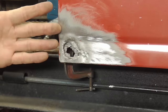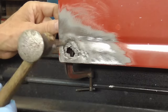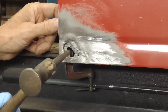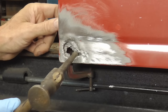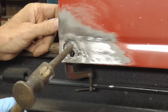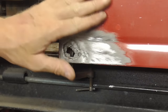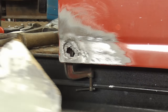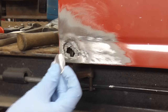The first step in using JB Weld as a solution to fixing a rust hole is to knock out all the old rust. Once you've knocked out the rust, you can grind this area clean and wire wheel it, or sand blast it — whatever you can do to get it cleaned up in there. Make sure that it's knocked down below the original surface.